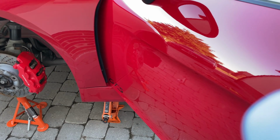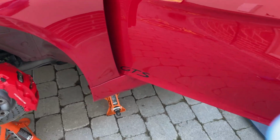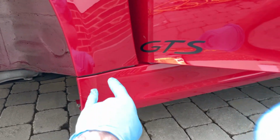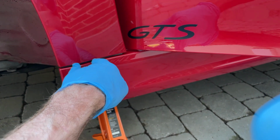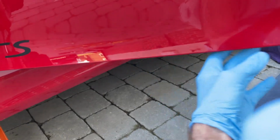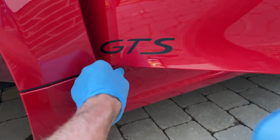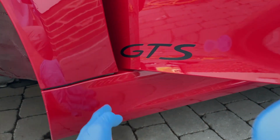Right, the sill is back in position now. Pro tip, it probably requires 2 people to put it back on, because you need one person down this end to locate those 2 press pieces in, and then basically just gently push them in. If you have the door fully open, it will interfere with the piece behind here, and you won't be able to get the entire sill far enough left.